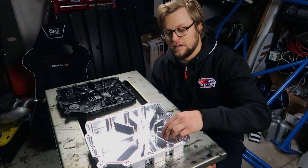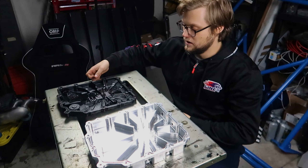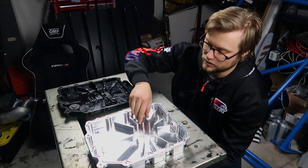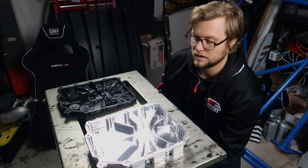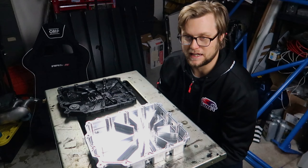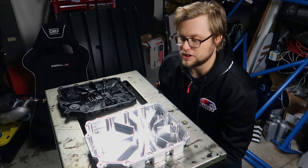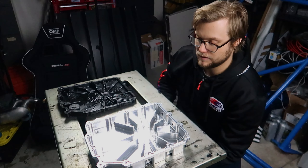To get the heat out of the oil, we have these big fins. First, the aluminum housing dissipates more heat — there's way more heat transfer using aluminum over plastic. Then we add these huge fins, similar to the fins on the factory unit. The oil won't want to slosh through this, so you'll have less aeration at the filter and pickup, which means you don't lose pressure. Oil pressure provides clutch clamping force, so the more pressure you keep, the better.